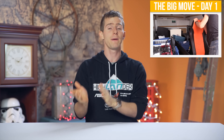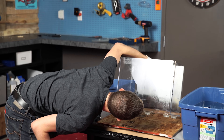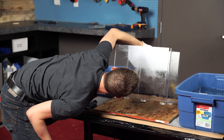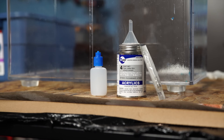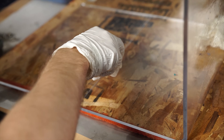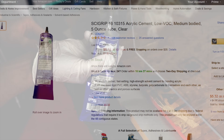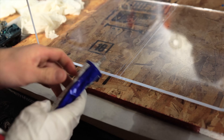So it's time to patch it up with the repair guide sent to me by John from Puget. One: wipe down the surfaces to be repaired — there's no need to get every last bit of oil off, as mineral oil is actually what they use to clean surfaces before welding. Because there was no single obvious crack, I needed to clean it quite well to see what was going on. Two: if you can identify the crack, drill a small hole at the edges of the crack to keep it from spreading further. For us, because these micro-cracks are between the overlapped pieces of the main tank, we're relying on the wicking abilities of our weld-on acrylic adhesive to fill in those gaps. Apply the acrylic adhesive with the application bottle and needle, then leave that for an hour to cure. Finally, apply sealant over the cracked area the same way you would apply caulking to a seal in your bathroom, then allow it 24 hours to cure.